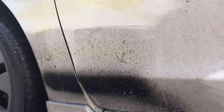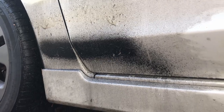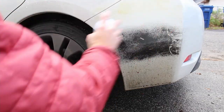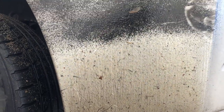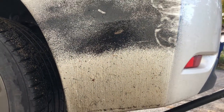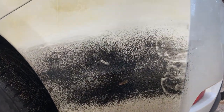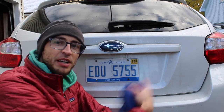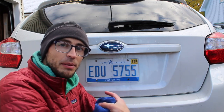If you're wondering why I didn't spray these on the underside of the car, it's because I wanted you to be able to see them clearly and how they perform and how they creep. Cars don't really show rust until they've reached three, four, five, or more winters, so a long-term test like that is a much different process. For the creep test, I taped off an area, sprayed it down, and then I'm going to remove the tape and see how far each of them creeps.